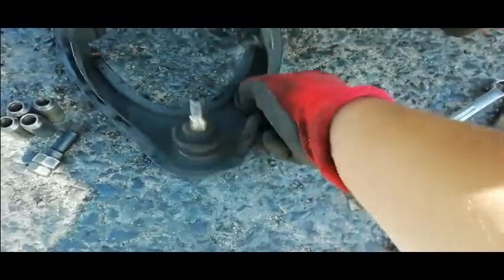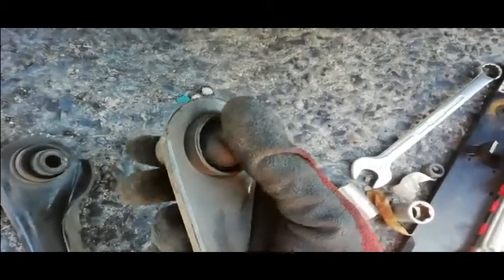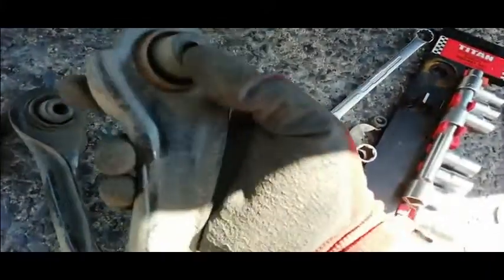I knocked on this thing here, and then the ball joint kind of just popped out. This is the control arm here. The bushing is also in its chops. As you can see, it's a bit flat. And the thing is, you see the bushings itself can move. You see how it's moving? These bushings aren't supposed to move like that. If it moves like that, then you're gonna get sounds, you know what I'm saying? Some nasty sounds that you don't want. It's like just another little bushing, and then I can push those bushings out.